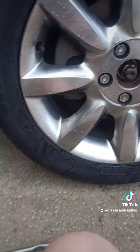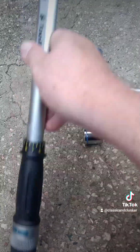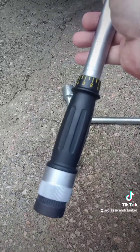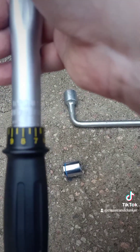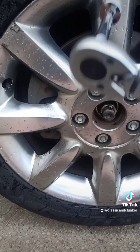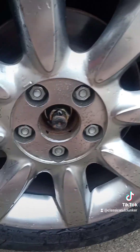They're on tight, but are they tightened down to specifications? In the manual it says 108 Newton meters. Thankfully, after having this torque wrench for about 10 years and using it once about 10 years ago, I finally have a use for it. I've lined it up to 108 — just had to put an extender on it because I wasn't able to easily clear the sidewall of the tire. I've tightened them up, so let's get the jack down and then give them another go on the ground until we hear the click.